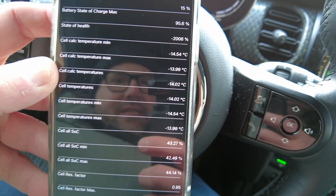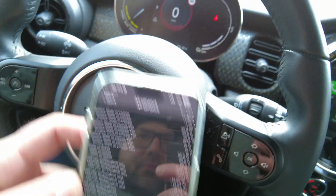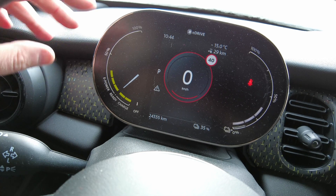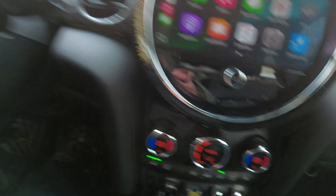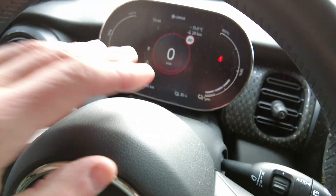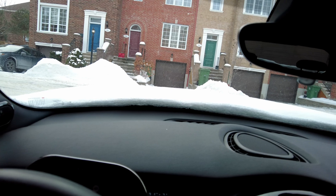It's been parked here for around 10 days — parked outside while we went down south. We took a cruise to the Caribbean. The e-power available is going to be very low; this car is going to have no power, and all EVs are like this until the battery cells start warming up. We're at 35% state of charge. I've started warming up the car. This battery pack is absolutely frozen — it hasn't been plugged in, and we've dropped roughly 30% state of charge since I last parked it.